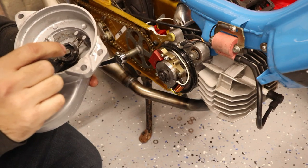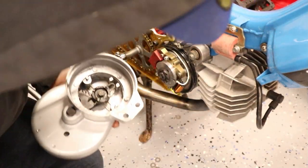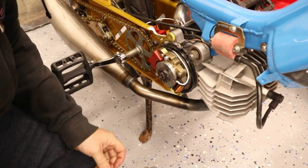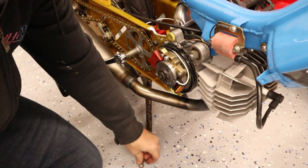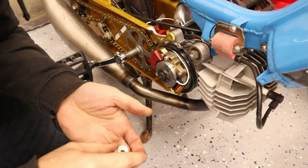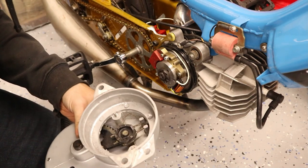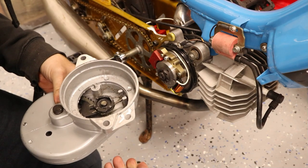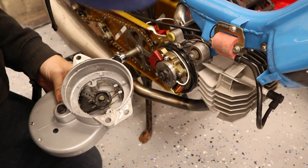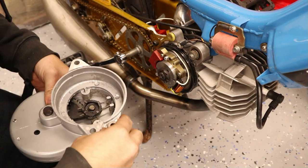First thing: there are two pins on here. Knock those off so that you can get a washer stack. When my lathe gets here, I will probably make up a proper spacer instead, but for the time being I just got five washers that fit under there. There were also two little casting nubs on mine that I had to get rid of, so I just ground them off real quick. Probably could have done it nicer in the mill, but it's more or less just trying to see if this could even work.